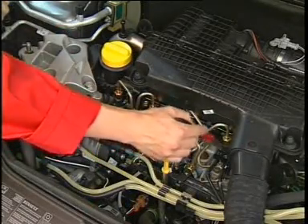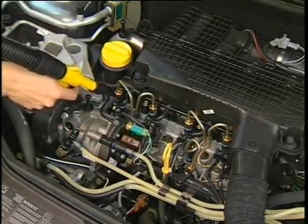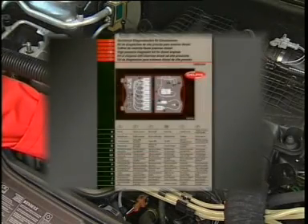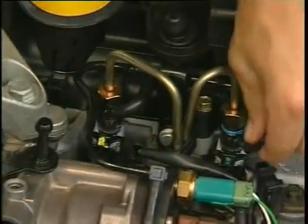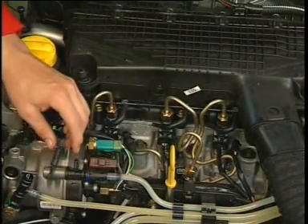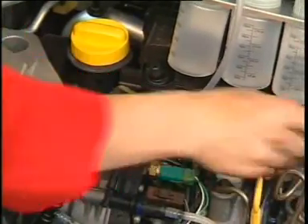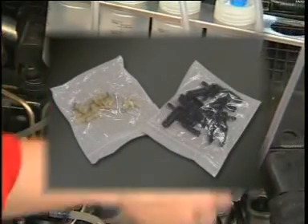The injector section of the kit is designed to fit engines with up to six cylinders. It comprises calibrated containers for collecting and measuring injector back leak, a plug kit and an explanatory guide. The containers are manufactured to be adaptable and can be fitted to all common rail applications. Depending upon the vehicle, the pipe connection will either be direct or can be made using the adapters supplied in the kit.